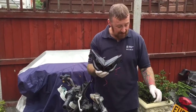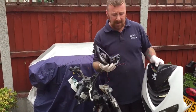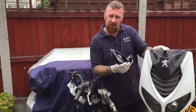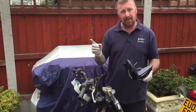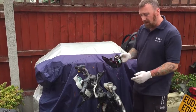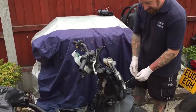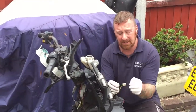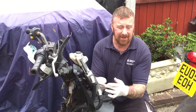These are good lights — they're probably brighter than the originals. What's illegal about them is there's no beam pattern. In Britain it has to have a pattern, which is a little cutoff line you see in cars. So you have to retain the original headlights. That just slots in — obviously that's a Yamaha one, I haven't got a Speed Fight one. I hope that explains it. Remember: green is your negative, green always on Speed Fights, and one of these two wires is going to be high beam and the other low beam.